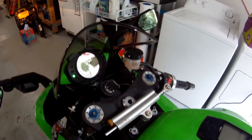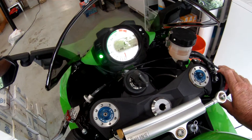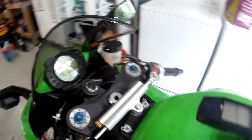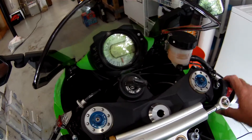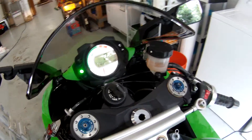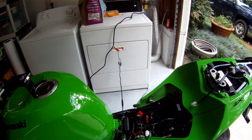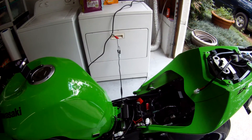The bike still will not start because the map has not defaulted to MS1 — we haven't cycled the key. Cycle the key, jumper's in, wait a few seconds, turn the key on, and the bike will start right up. So MSO to MS1 does not switch on the fly. You have to recycle it.